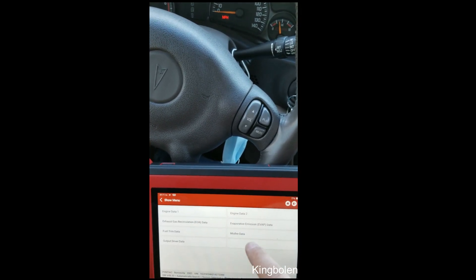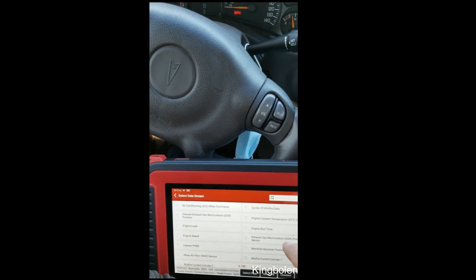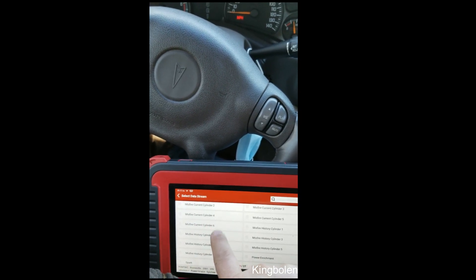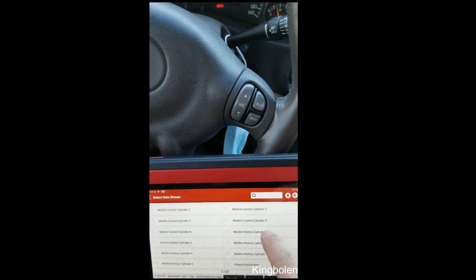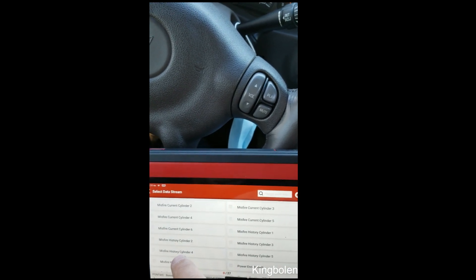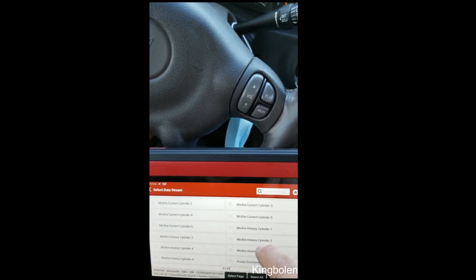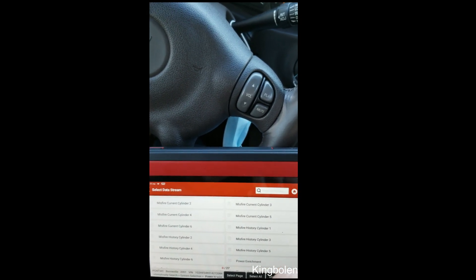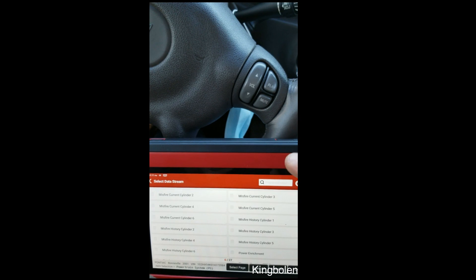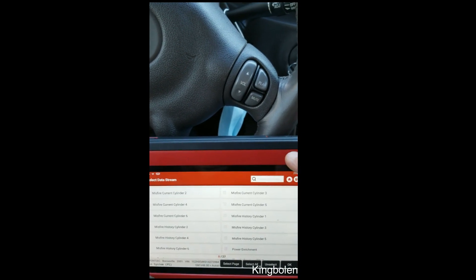Those can be really hard to find. I used this tool on this Bonneville, and by hitting misfire I was able to go down here. You've got current misfire and each cylinder — all six cylinders are laid out. And you have history misfire — history is what happened in the past, and your computer knows. This tool can pull that up, and this is a powerful function because I didn't have a check engine light to tell me which cylinder was misfiring. And it was very hard to figure out which one was missing. This tool is faster than any of the tools that I own, and it found the misfire — and I did it all from the driver's seat of the car.